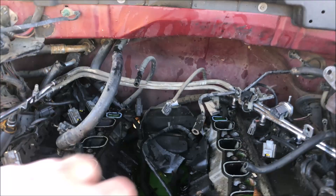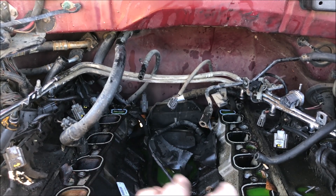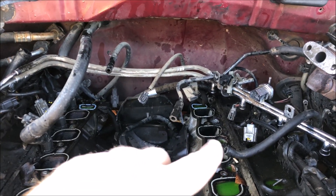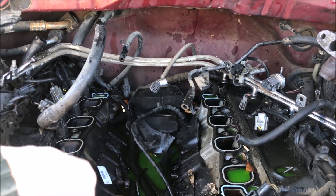It's not necessarily the easiest thing to do, but it's doable. The hardest part are those two bolts in the back that hold the intake manifold down — there are five bolts on each side. I took the fuel rails off first and removed all the coil packs, which gave me access to those last two bolts, which were a little difficult, but as you can see I got it done.